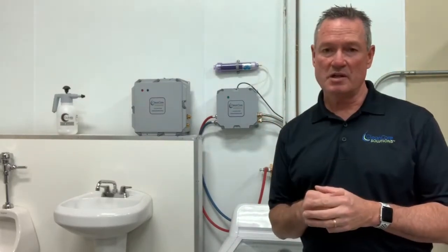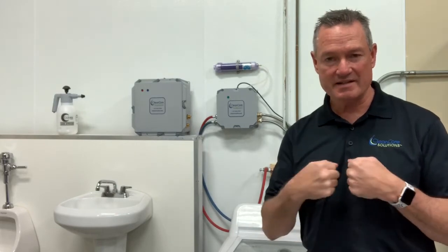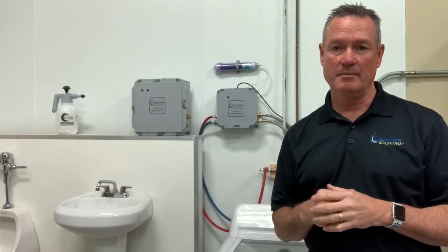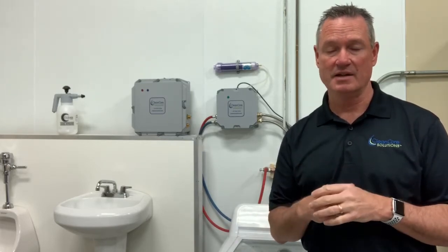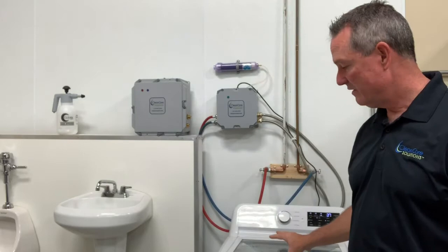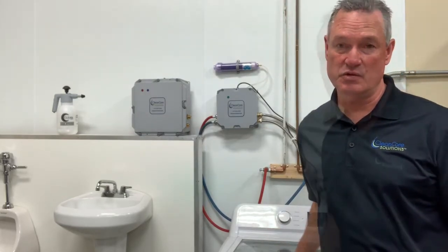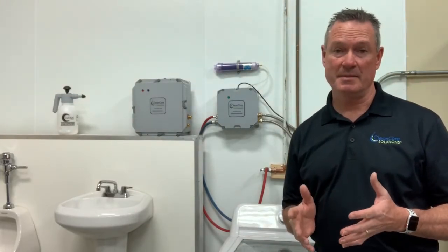Because the ozone molecule gets into the fibers of the fabric and spreads those fibers out, it does a couple of different things. First, because of that spreading out of the fibers, it does really well on whites and colors. It also provides a drying sensation inside the washing cycle. So when you take the fabrics out of the washing machine and put them into the dryer, you're able to get about 50 to 60% less drying time in the drying cycle.